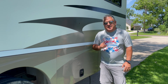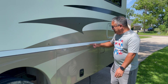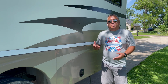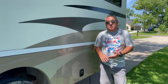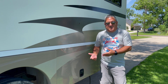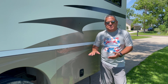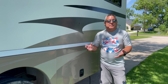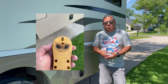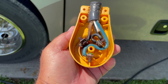We're going to have a great time. I apologize about all the crickets — this time of the season here in Texas you also see all the mayflies coming out, even though it's June. But as you prepare, you always want to double-check your rig and look for things that could be a problem. One thing I noticed that happens a lot for us, especially since we go to a lot of rodeos and rodeo grounds — the campgrounds they have and the power pedestals usually have some bad receptacles, and it can cause shorts and issues in your power cord.